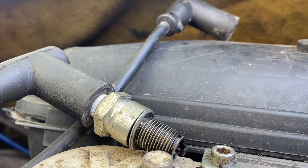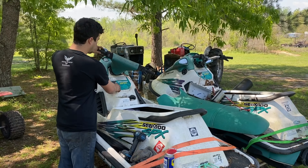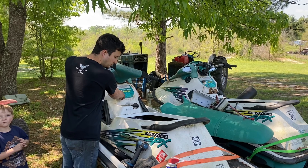Got the stator, sprayed it out with brake clean. It was painted tan, so it's a little bit off color now with the rust. Got her cleaned up. I'm going to sand the pads just to make sure there's no rust on them, and then we're going to put the flywheel on there and see if she's got spark now. I think we're just going to refurbish this one - by that I mean clean it.